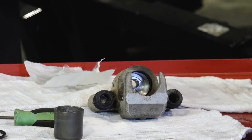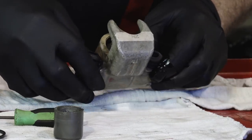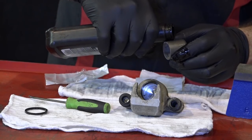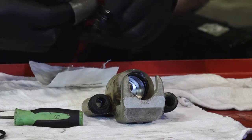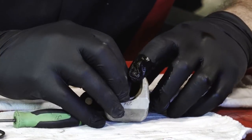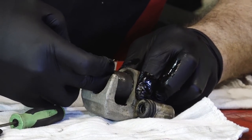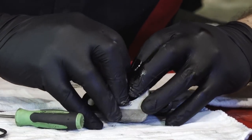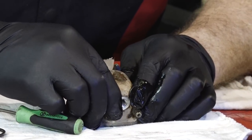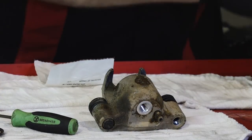Just make sure there's no dirt or dust in there. Before you put your piston in, go ahead and coat those seals down with some DOT4 brake fluid. When you're inserting it, you want to make sure you do it evenly so it doesn't get stuck in there. There we go — and that went in a whole lot smoother than it came out, something that may have solved our problem. Go ahead and bottom it out.